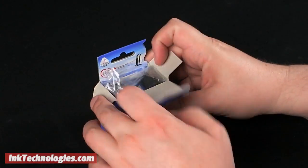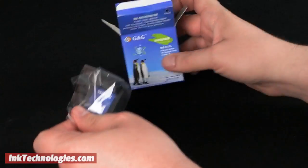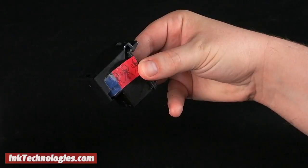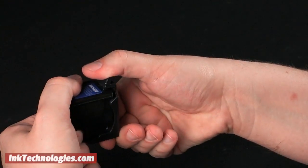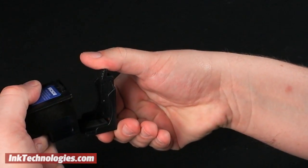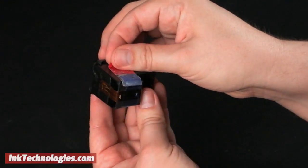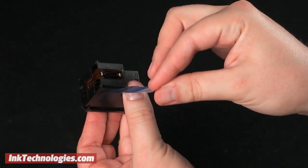Get the new HP 3051A cartridge prepared by removing it from its box, then carefully open and remove the plastic bag as well. While squeezing the handles of the plastic protector, pry it away from the cartridge. Before installation, make sure you also remove the strip of tape at the bottom.